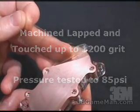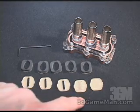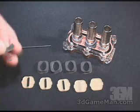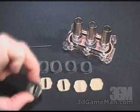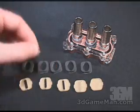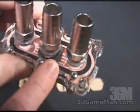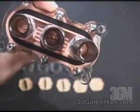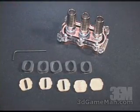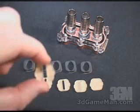Something new with this particular water block is an accelerator nozzle kit. These are the different nozzles — they also include some rubber with a peel-off back so it sticks to the nozzle. You install this into the center part of the CPU water block. They also include a tool so you can take off the top. Looking in the center you can see one is already pre-installed, and you can see that nozzle. You might want this to adjust the flow control of your particular system — maybe you want more flow or maybe you want less.